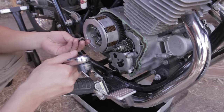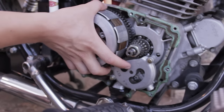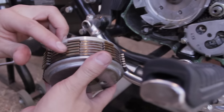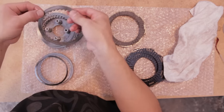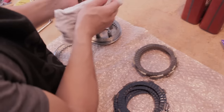There we have it — do not lose this. There's a washer, don't forget that too. Now you can proceed to pulling out all the clutch discs. What we're replacing is the individual discs. Check the surface of these discs, and if it's just too shiny, you want to scuff it up with a very fine grit sandpaper so it catches.